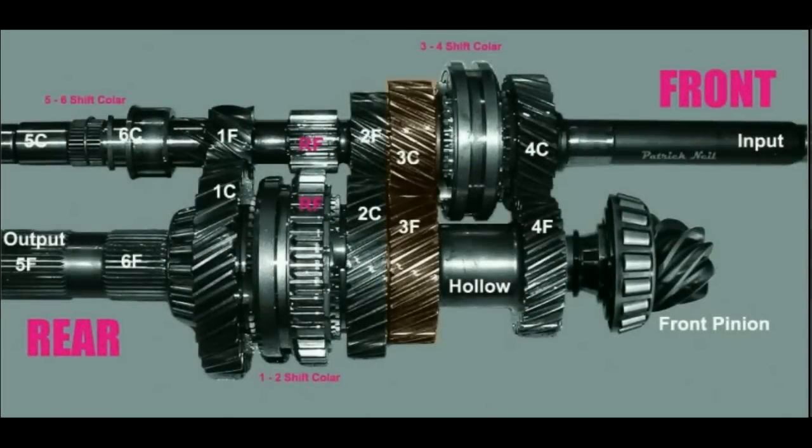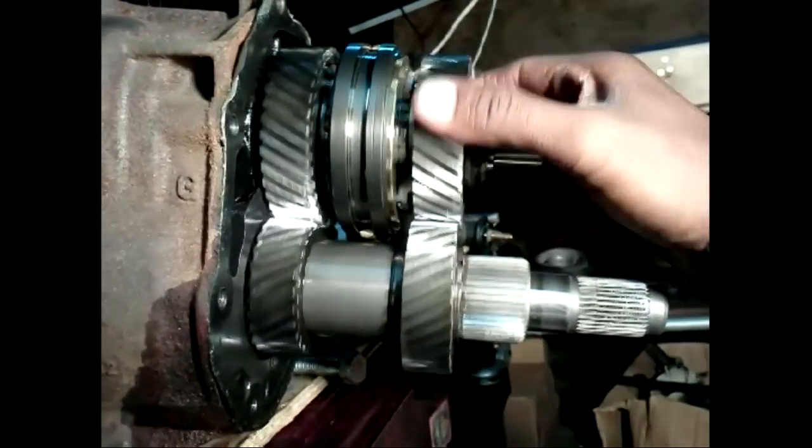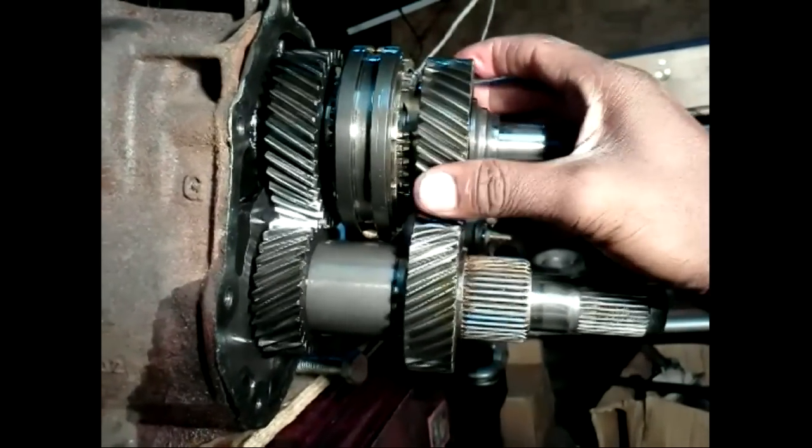The gear chain mechanism consists of two gears called a gear set. One gear is fixed to the shaft, while the other is free to rotate. One gear is the driver gear and the other the driven gear. The driver gear is the gear with the power, and the gear it mates with is called the driven gear. In first and second speed, the fixed gear is the driver, and in third through sixth speed, the floating gear is the driver. All gears, except reverse, rotate at the same time.